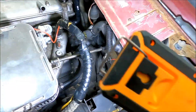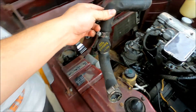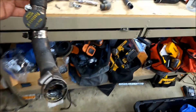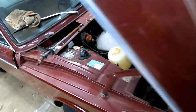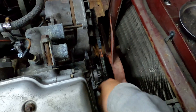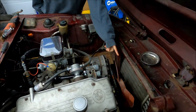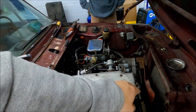Here's where the next hose is — we're looking at the back of the intake manifold going through the firewall into the heater core. I just flung rusty coolant all over my face. For these last three hoses and the thermostat, we needed to get the fan and the radiator back in. It was a pain to get the bolts through everything into the water pump. We put the fan on probably four times because we kept remembering all the other things we needed to do — we forgot the pulley, then we forgot the alternator and couldn't get the alternator bracket back on with the fan in place. So live and learn: put the alternator bracket back on before you put the fan and pulley back on.